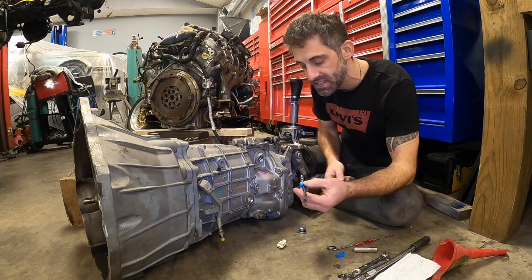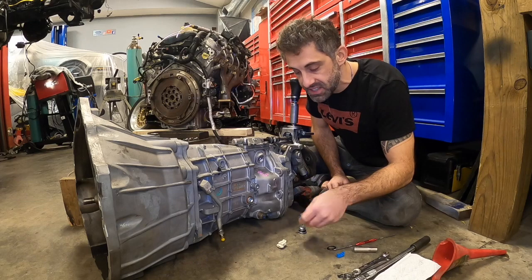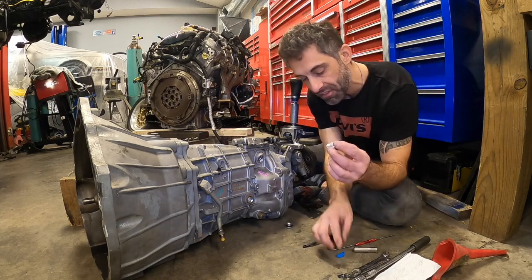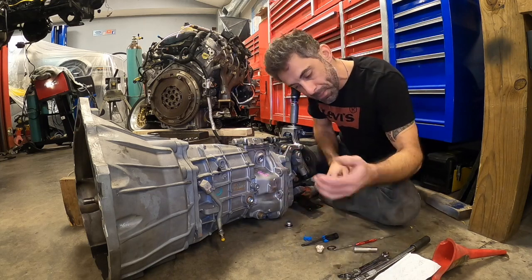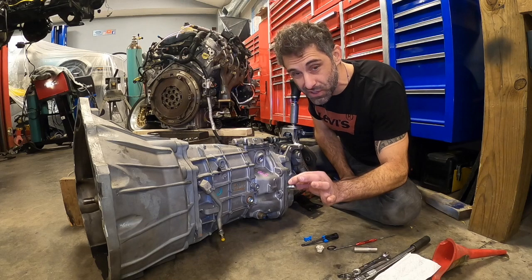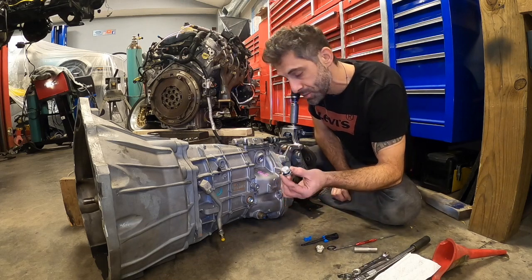This kit is basically a 37 ohm, half watt resistor that plugs into that and tricks the ECM. The other side, in many cases, you can leave the sensor there and just plug it up with a fake plug that has no wires to it. It basically plugs right into there. For most people who want to do a quick and easy wiring swap only, you can do that. In my case, since I have limited space in the transmission tunnel, I bought a plug. Both parts are down in the description, you can take a look at.